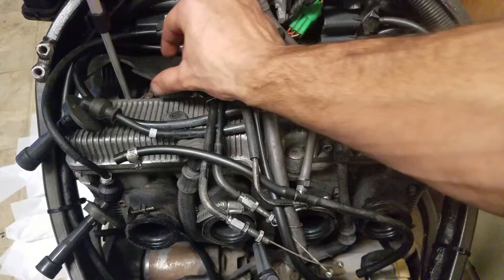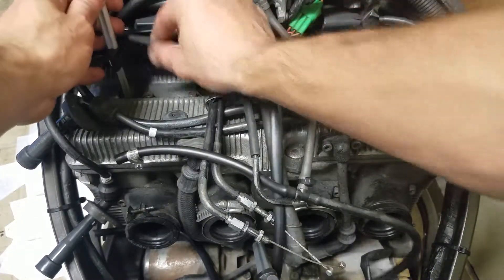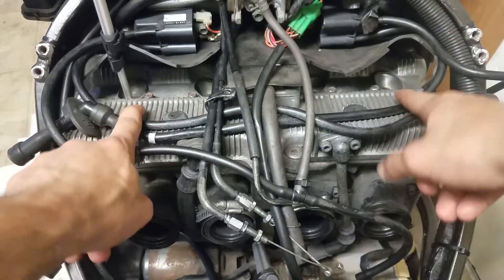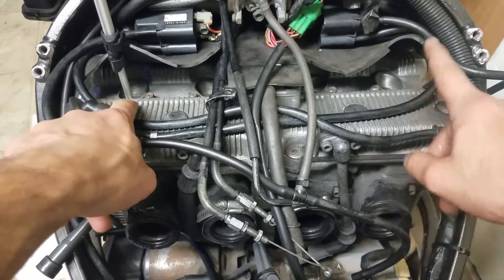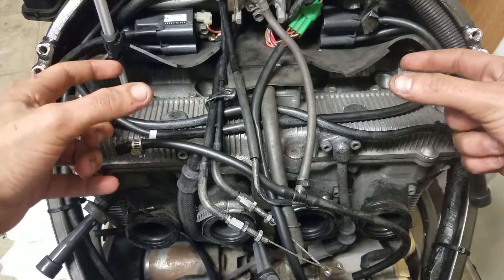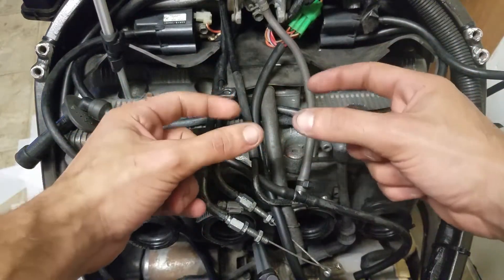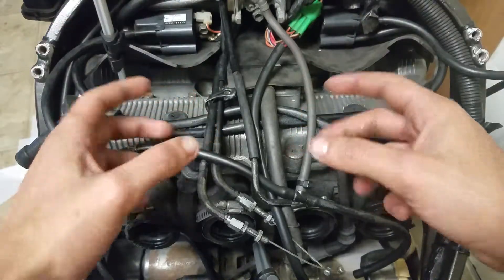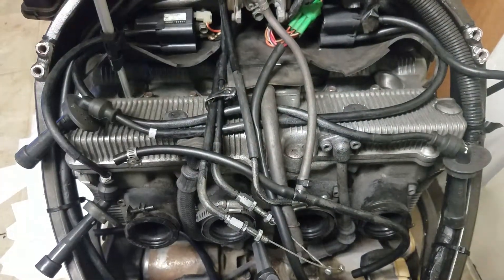With the concept of four inline cylinder bikes, you have cylinders — I'll just call them one, two, three, four. Cylinders one and four, the pistons should be at the same height, whereas pistons two and three should be at the same height — either both up or both down, but they're always together. That's what we're trying to check today.